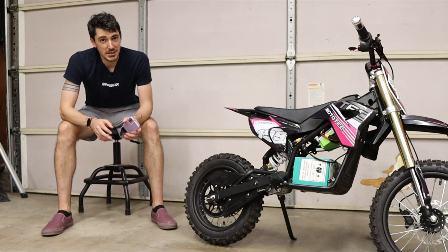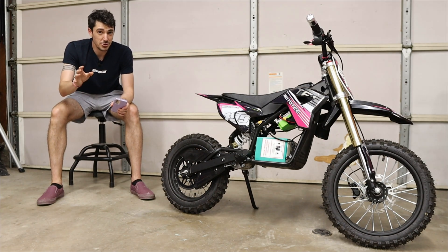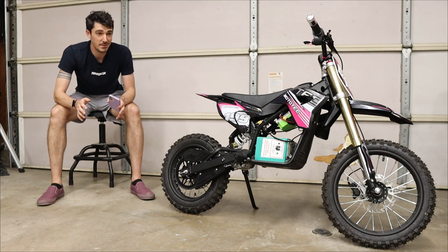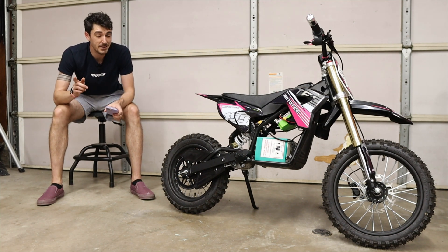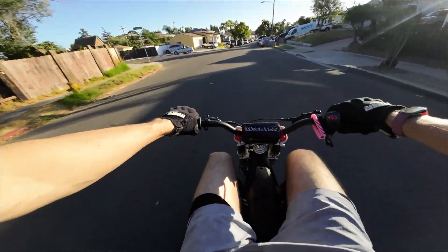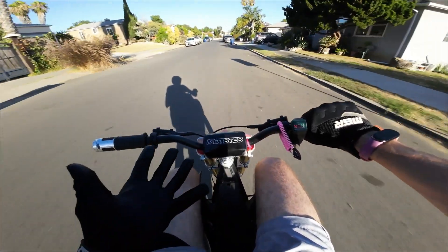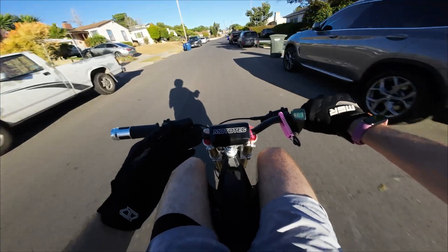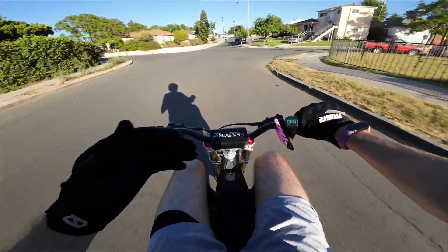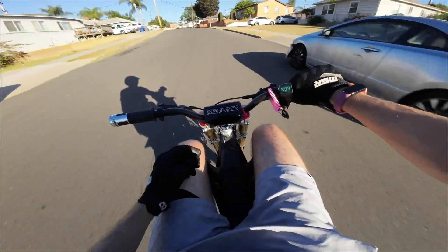Finally, I had to throw in the towel and admit I had no idea what I was doing. So I reached out to an expert, someone who's very well known in the FarDriver tuning community, and they were kind enough to help me out with a custom tune. They went in and changed a bunch of parameters I didn't even think to change, let alone know what they were. And it didn't work, but it didn't do nothing. Of all the parameters changed, I think the secret sauce is the max phase current. Previously I had it at 100 amps because I figured I was being safe, but phase amps are about torque. So we upped it to 220 amps, and now with more torque, even though the judder is still there, I'm getting past that RPM a little faster, so it's not as felt as it was previously.